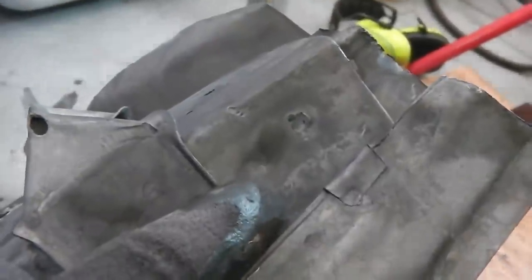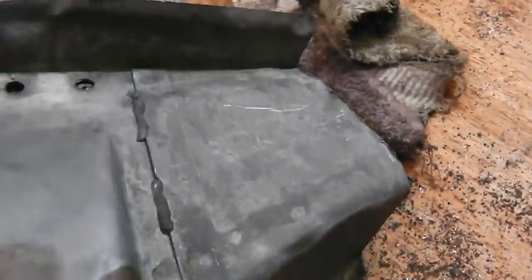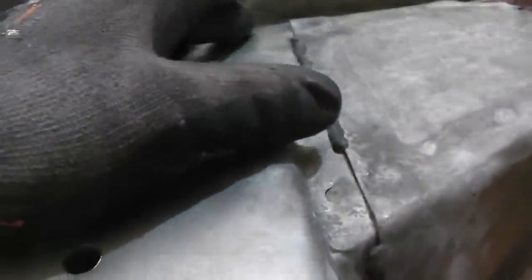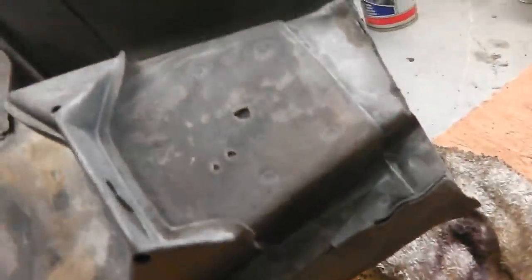we need it up to there, nice and intact, but you can see there's some horrendous spot welds going in the two pieces. So the best way to do it is to take the remnants of the boot floor off, then you can get inside here and break away the leg. What you're talking about is this piece just up here, that leg that goes under the boot floor there. The bits of that are going to be stuck in here, so we've got to not be able to get to any of the spot welds. We can get to the spot welds that hold the remnants of the boot floor on, lift it off like a cap, and then inside you'll see the remnants of this leg. Look how it goes underneath there, see?